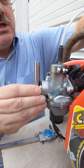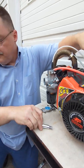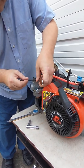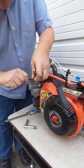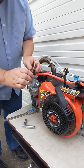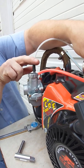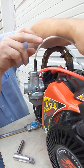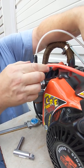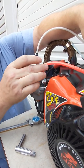For instructional purposes, let's go ahead and pull the slide loose, take the cap off of it, and show you what I mean. We'll next loosen the cap and gently slide it out of our way. I'm just going to back the cap off a little bit, and as I pull the throttle open, now we can get an extra few thousandths of opening on that slide. That's why it's important that when you're racing this slide cap be tightened to where it's snug. It cannot be run loose because it will allow air to get in around the cap, and it also allows that slide to open further.